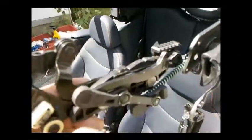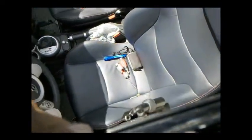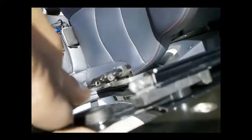You want to make sure this is in the forward position as you slide it in. This is the hardest part of the repair because you've got to get everything back into the proper location. Basically what you want to do is start by pushing the cable back in — push it in until it's just a little bit in like that. When you put your locking mechanism in place, it automatically hooks right to the path.